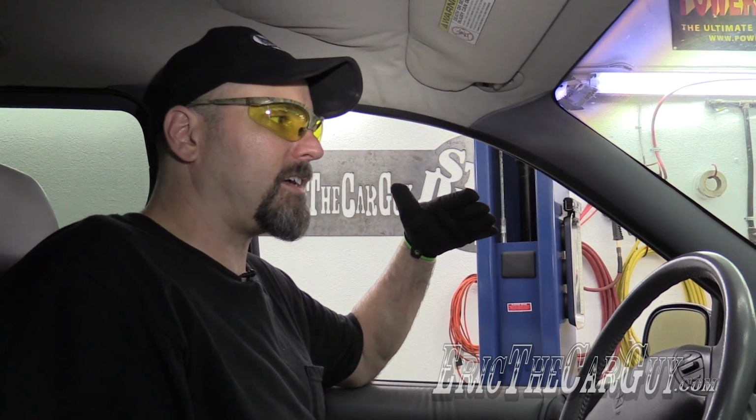I think whatever controls the fans is sort of messing us up a little bit because they're not allowing it to cool as efficiently. I mean, you want to see higher high side pressures. The system is now full, but if I'm going to hazard a guess, I'm going to say that it's something having to do with the fans, but it's still cooling 20 degrees. Just wish it was better. And all that work for one little line, well, one little valve, I should say.